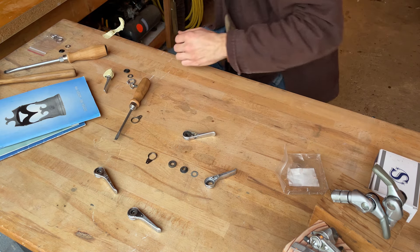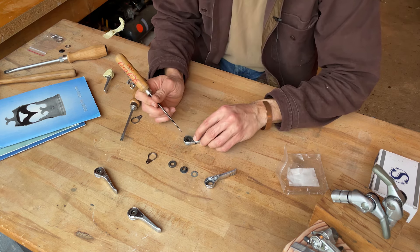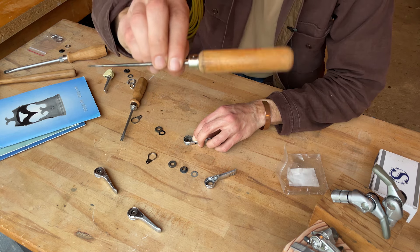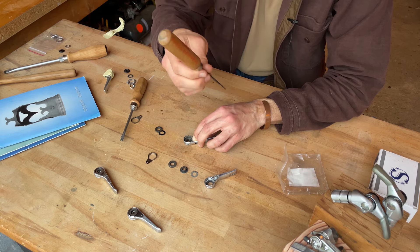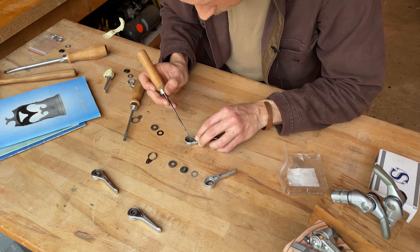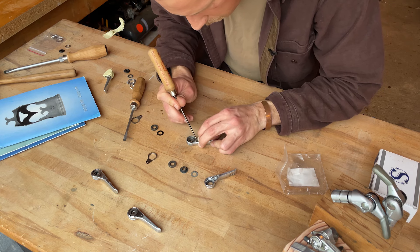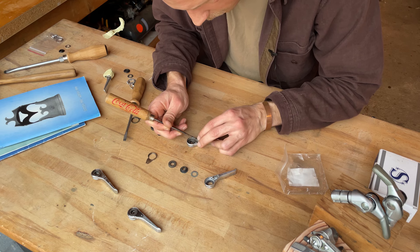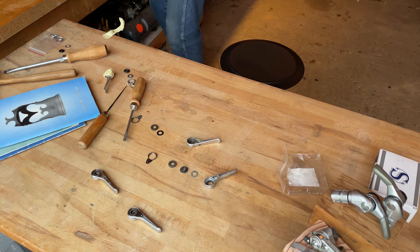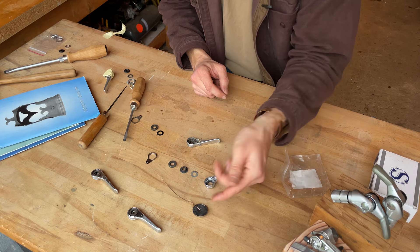This is sort of a delicate operation and in the past I have had these pieces come loose and go flying. What you want to do is put your finger over the spring and the pawl and then lift out the ratchet with a pick. I recommend using a vintage Coca-Cola ice pick if you have access to one, because they're beautiful and they're cool. So now you have your ratchet and your washer removed and the pawl is free. The pawl goes in this little slot. The trickiest part to remove is this spring — it may want to fly across your shop. If you're very careful you can get the spring out. One thing that's really helpful is to have a magnet around, just a little fridge magnet, and take that steel spring and put it on the magnet so it doesn't roll away — it just stays stuck to the magnet.